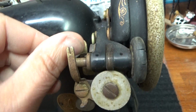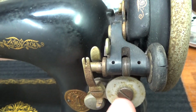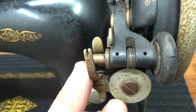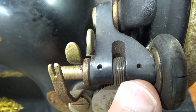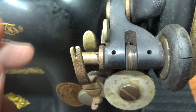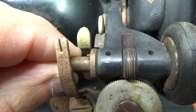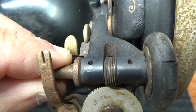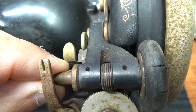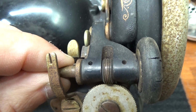So, disengaged, engaged, disengaged, engaged. And also, if you already have one of these, these two little holes are not for ventilation. Hole number 1, hole number 2. These are critical lubrication points for this bobbin winding assembly so that this turns freely, which, yeah, it's not turning at all right now. Deep breath. Barely. I feel like I'm hanging on a cliffhanger, and it's not going to work.